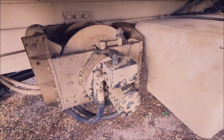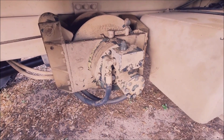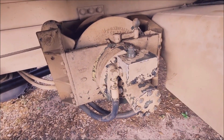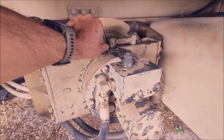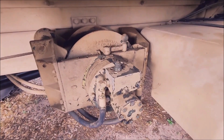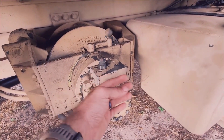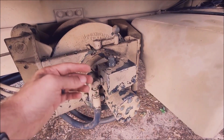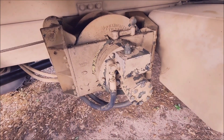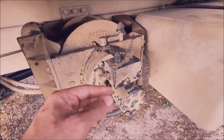As I was troubleshooting it, I turned the PTO on and off a couple more times when we were checking the leak underneath after we tightened it up, and it stopped. You'd come over and finger it and a little bit would dribble out. When we pulled this off, that fluid leaked out but this part of the system stayed closed. It refilled that side and it never puked again. If you go through and install this, expect it to puke because it's going to purge air.